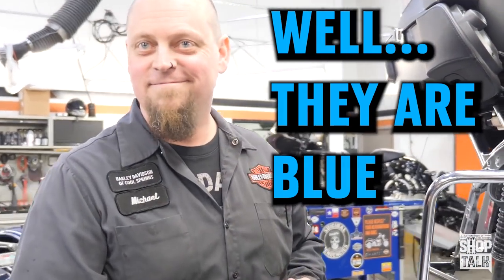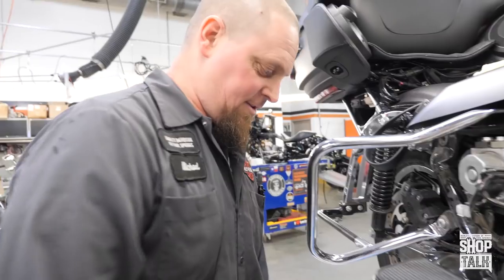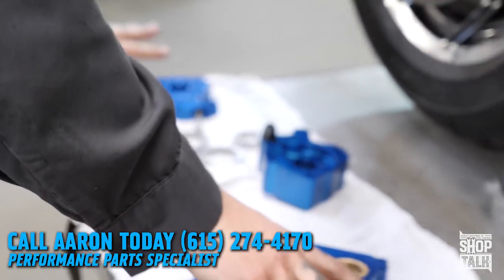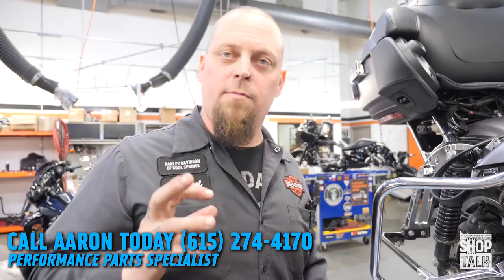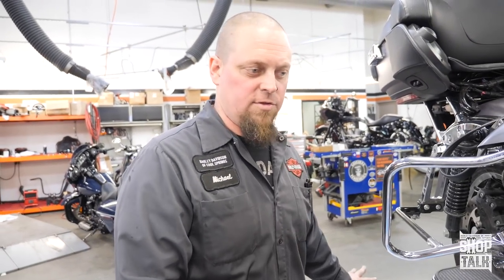The S&S plate is billet with bronze carrier bushings, so that if there is pressure or wear, it wears through the bushing before the plate, and these bushings are replaceable. Everything on the S&S pumps is rebuildable, so if there is any kind of failure you can buy just that one component and replace it. With OEM, if something goes wrong with your oil pump or cam plate you have to buy the whole thing — with these you can buy individual parts and repair.